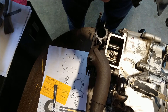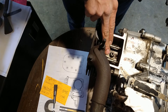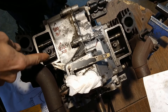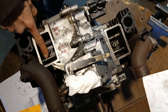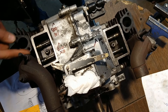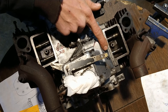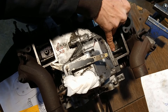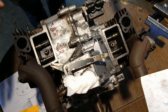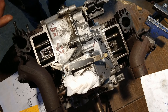I'll be back with an update on what we're going to do about the guide. After we get that figured out, we'll go back to the other cylinder, double check the valve clearance, and once we ream this guide we'll verify the valve is still seating properly. If you ream the guide slightly off it can cause geometry issues at the valve seat, so we'll be very careful. Then the final step is to grind the valve stem for the proper clearance.